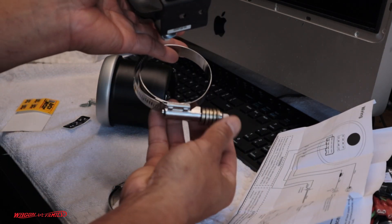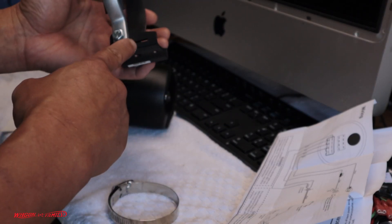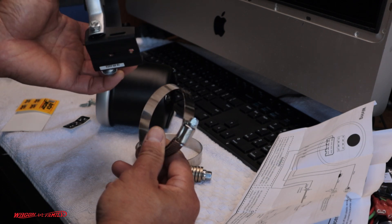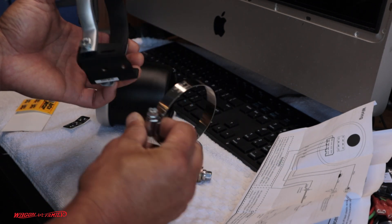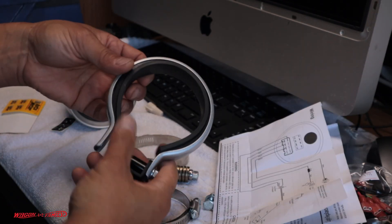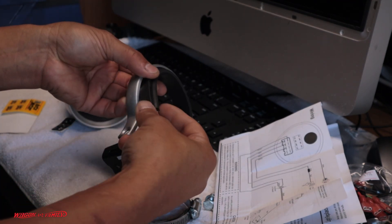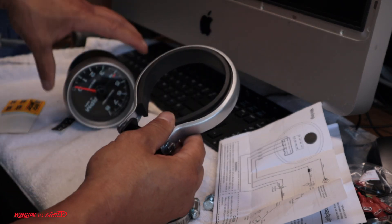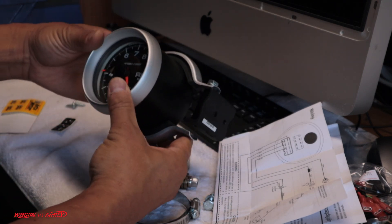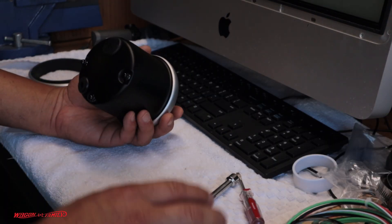I really wanted to use this heavy-duty hose clamp — man, look how cool that would look — but it's obviously overkill and way too wide. So I'm going to use a standard one. This is about a two-and-a-half-inch hose clamp from NAPA. The size is one and three-sixteenths to two and three-quarters. It has an integrated rubber gasket on the inside of the mounting bracket — they're pre-molded to fit in the housing perfectly. Basically the gauge is going to mount somewhat sideways on my steering column.